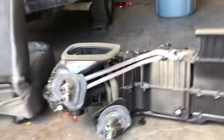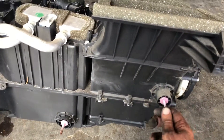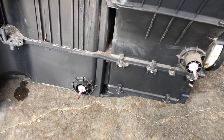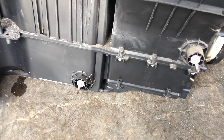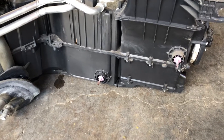I wasn't going to make a video about this because there are already some good videos out there, but they glossed over how to get this air box out. There are two bolts right here that if you don't know they're there, it's going to take you forever to find them. They're literally behind the engine — you have to take the inner fender out and reach up behind the tunnel. There's a mechanic that made a video on how to do this but he leaves this off because he wants you to take it to him.